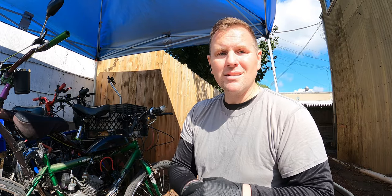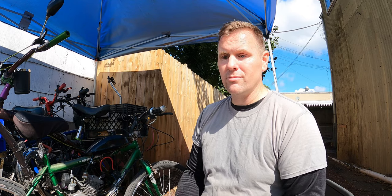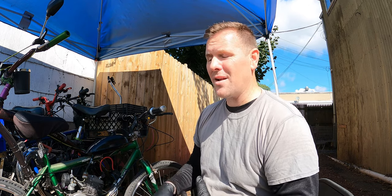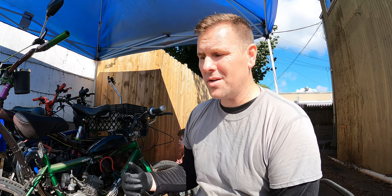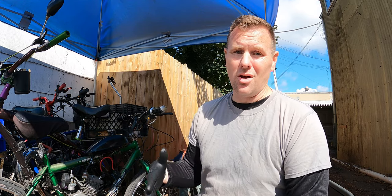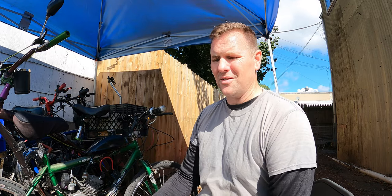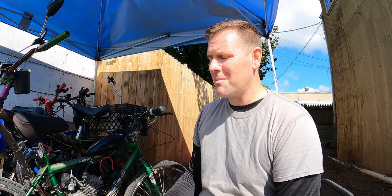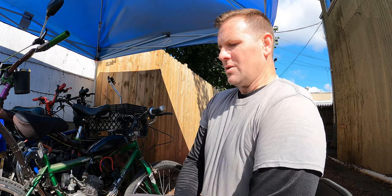Now, out of the box, they're horrible. They have no power. They are little stump pullers, 100%. Right out of the box, it will just chug along no matter what's tied around on it, dragging anything. It will just go, but it's not going to go fast. It basically was topping out at like, I don't know, 15-ish, 20 miles an hour maybe, with a 44 tooth sprocket and a 26-inch tall tire. So it doesn't really scoot around very fast.